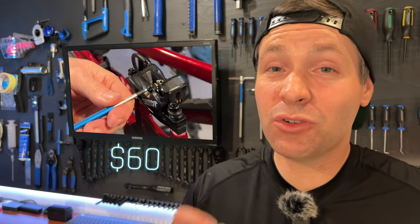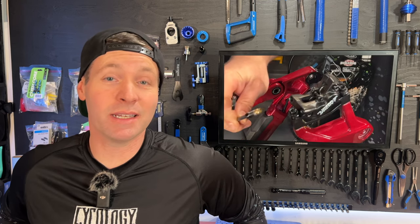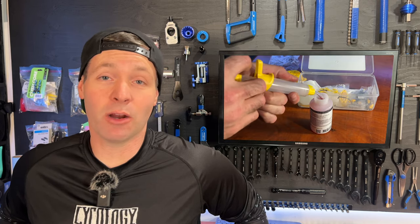I'm gonna take out this 2-piston caliper and swap it out with a 4-piston one. This should double the force pushing the pads onto the disc, and the pads are also wider, so more surface area biting onto the rotor. Swapping out the caliper was a piece of cake. All I had to do was disconnect the old one, and the new one just slid right in. The only tricky part is when you disconnect the hydraulic line, you introduce a little bit of air in the system. So a full brake bleed is necessary to get rid of all the air bubbles.